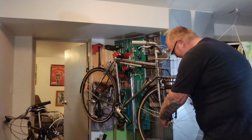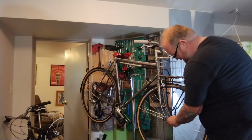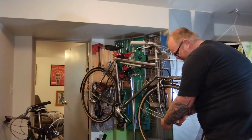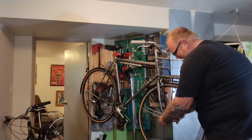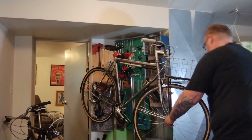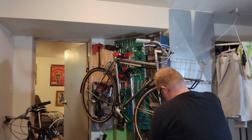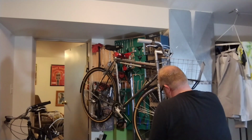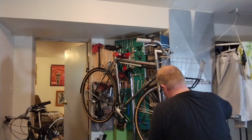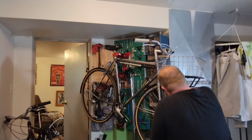Okay, now that I set that brake in, it's a little tight. Up and over, babies. This should probably really only be done with a bolt-on axle, lots of extra threads. But, sure, a million guys have done this and it's been totally fine. In the worst case, I could go find another axle with the same amount of... Oh, that's right, this fork's a little 2 millimeters too tight.